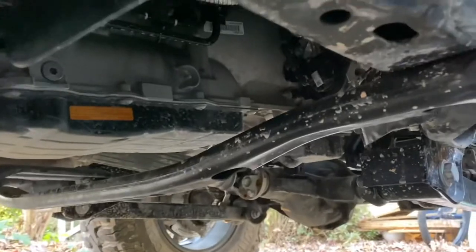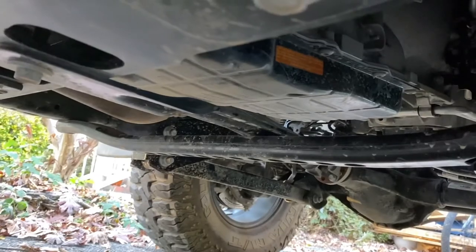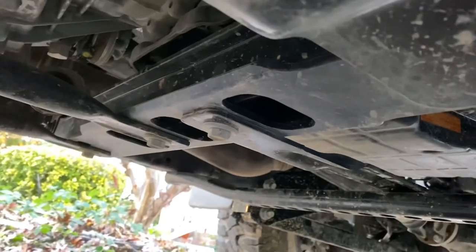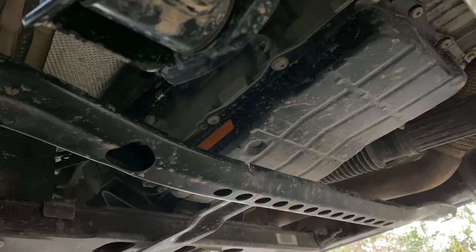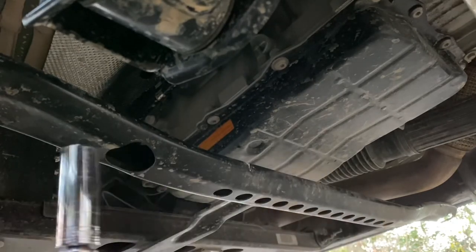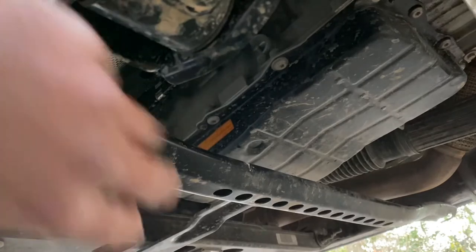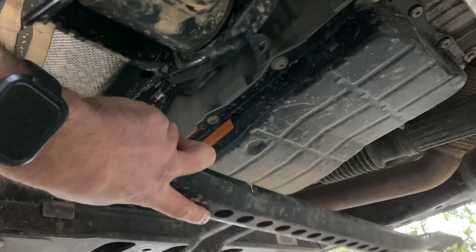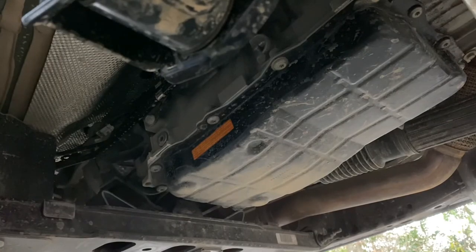If you're like me and you're on your back in your driveway, you've got to take this rear cross member off, and then you've got to loosen the bolts along the transfer case cross member as well. These bolts come off with an 18 millimeter socket. There are three bolts — the one that goes to the transmission cross member you take off, then one on each of the frame rail sides. That comes down because it's being replaced by the full skid plate.